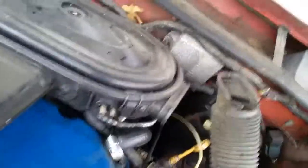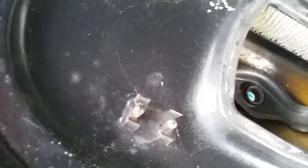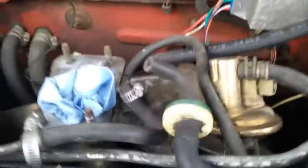You've got to disconnect all of the vacuum lines and then this guy can pull up. A lot of times there will be another valve here — I can't remember what it does or what it's for — but this will be connected to something down inside your intake manifold area. I believe it is hooked up to this weird S-shaped hose with the yellow and green valve on it. That's something that's different on all EXPs with 1.6 engines.